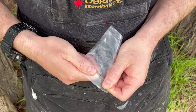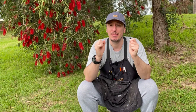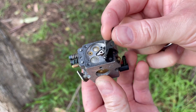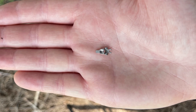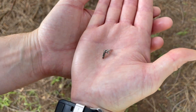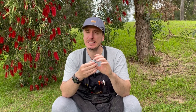Of all the parts that can be removed and replaced to service one of these carburetors, there is one that requires an essential adjustment before it's going to work properly. Inside the metering chamber — the side that meters and supplies fuel to the engine when it's running — you'll find what's called a metering lever. This is a forked tab that holds, opens, and closes the fuel inlet needle, and on the other side there's a tab, and between the two there's a pin which allows the metering lever to pivot, opening and closing the fuel supply.